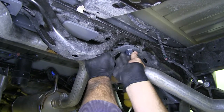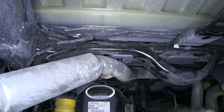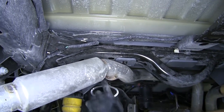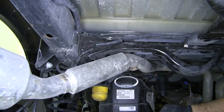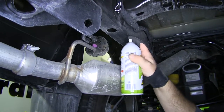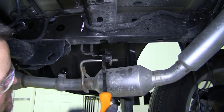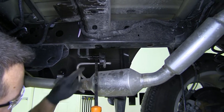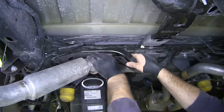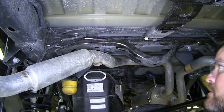We'll have a large flange nut for each bolt. I've determined that my nut is not going to fit up in there with my exhaust pipe in the way, so I'm going to have to move the exhaust to torque this bolt down. I'll pull this hanger off and then the most rear hanger — that should give me enough room to get a socket on it. I'll spray just a little bit of silicone spray to help them slide off easier. We'll take our crowbar, wedge it up in between, push up on one and down on the other to pop it off. For the front hanger, it's just two long pins — you can push it off by hand.